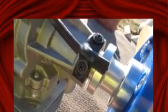It didn't seem to cut through. I didn't see a hole or anything, so it seems fine. But that's what I did to get a tad more range to get it down to 30 degree timing, because DLE stock timing when this is centered is 35 and I think you were able to get to about 34 or so. So I milled it — I mean took an X-Acto blade to it — to get it to 30 degree timing.